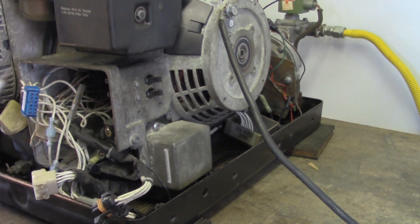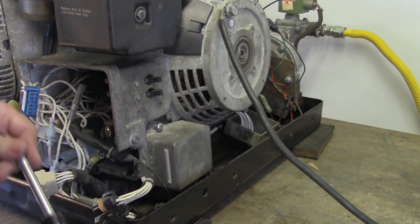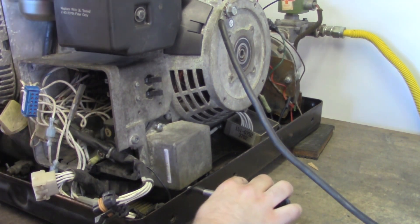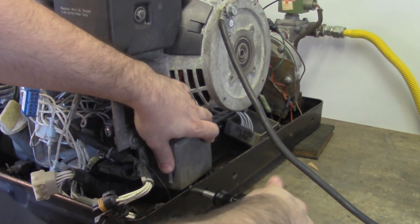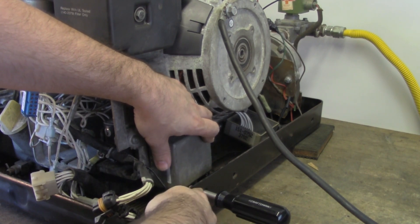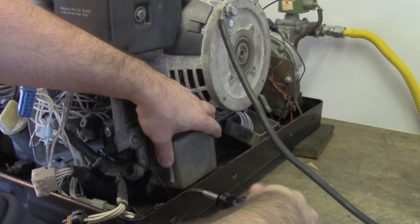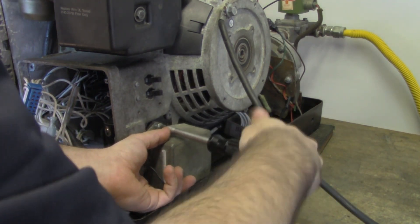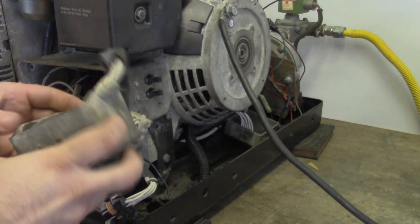Let's get that connector out of the way. We're going to take our T30 and start taking these screws out. The first one is the easy one. You might want to leave that in place just a little bit, because the second screw is underneath, and you go through this hole in the frame to line it up. Once you're on it, give it a turn — that's where your ratchet comes in handy. A lot of generators are mounted by the bottom tray, so you might not even have access to this hole; if that's the case, you'll have to dig down through there. There's our voltage regulator — the 826 regulator.